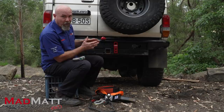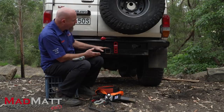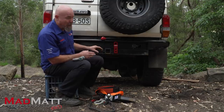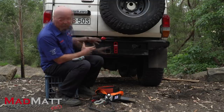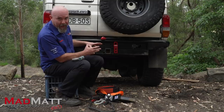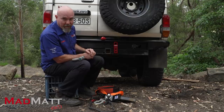Over thousands of vehicle recoveries, for the most part, we're not seeing these fail — assuming they're in good condition, bolted to the chassis with serviceable bolts and all the normal stuff in place. We're not seeing bending or failing. Through experience we've come to the conclusion that something like this is acceptable for a vehicle-based recovery, but it's not actually designed for it. If you have a tow bar without a hitch receiver — not a heavy-duty bar — be very cautious about doing a vehicle-based recovery off that.